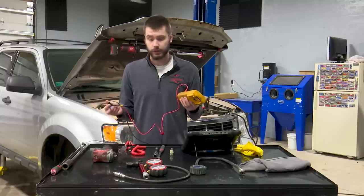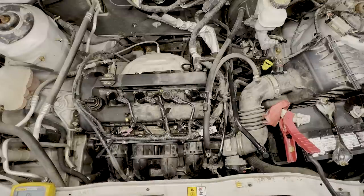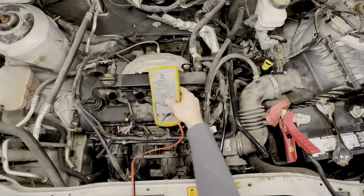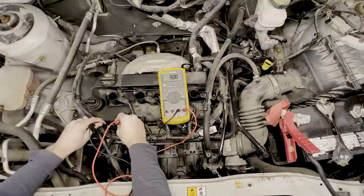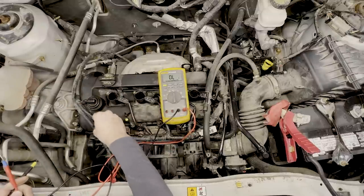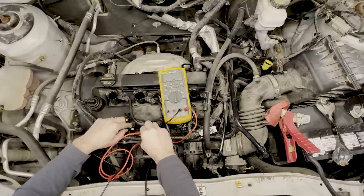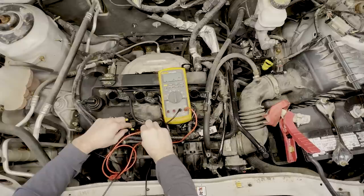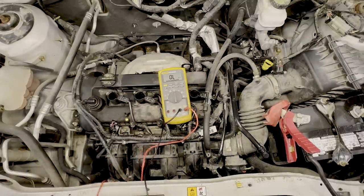We can do a quick comparative test on the coil windings inside the injector just to make sure they look good compared to the others. I don't love resistance testing since it's a static test, but we're going for the lowest hanging fruit — I already think this is probably a mechanical issue. Our injector resistance is about 13.8 ohms. Comparing to a cylinder that's not misfiring, I'd expect within one ohm. The other reads about 12.9 ohms — a little higher on the problem cylinder, but not open and not shorted.